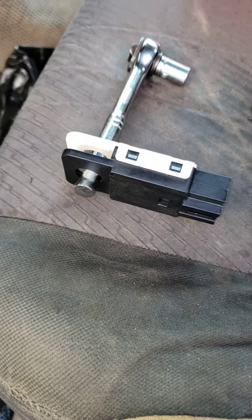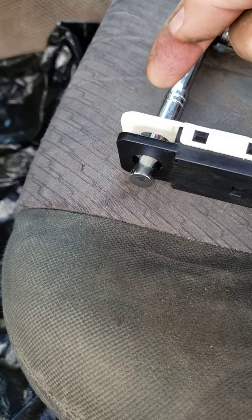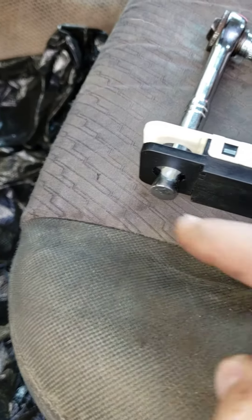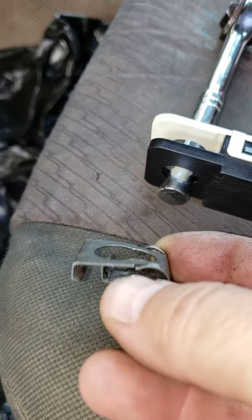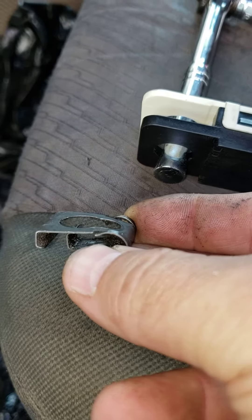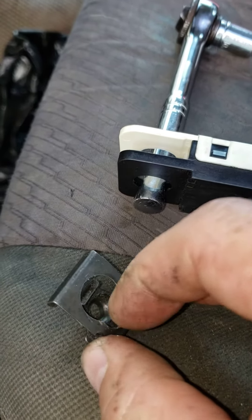Underneath the dash, we're simulating the stud on the brake pedal — it's going to come through the switch and come out on the opposite side. On that rod on the brake pedal, we're going to take this clip here and slide it on the bigger part of the circle to the left, then push it to the left direction and it's going to lock on to the smaller half of the circle.